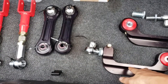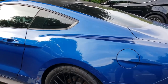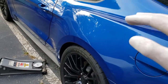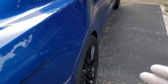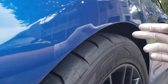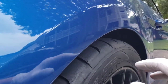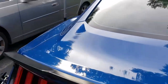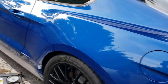I just switched over to the drags about a month ago, but prior to that I noticed that the left rear of the car would sit about half an inch lower than the right side. You can see it in the fender gap — the drag springs sit a little higher in the rear, but you can tell from side to side that the left side was lower.